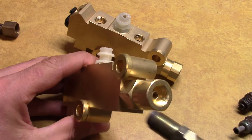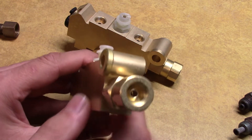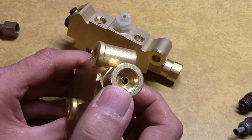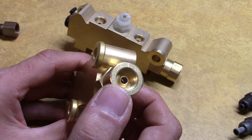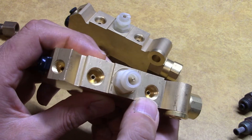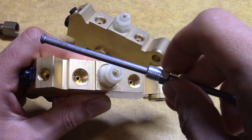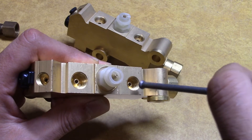These things are being sold for applications where people use them with three-sixteenths line in the back. Look a little closer when you go to do that and maybe contact your distributor and question it — it will work, it may not leak, but it's not right. All the other cones in this particular one seem fine for three-sixteenths line. Here I have a three-sixteenths line — I'll hold the nut back — that's your standard three-eighths thread nut that comes on most three-sixteenths brake lines.